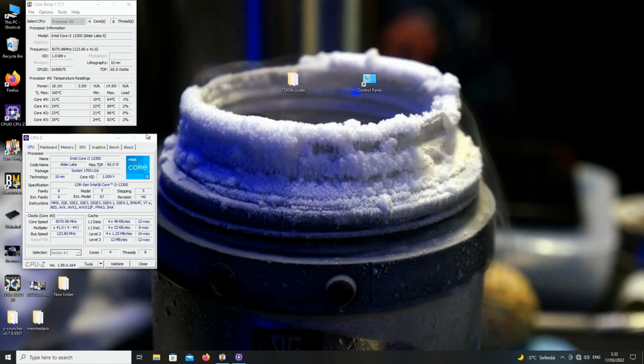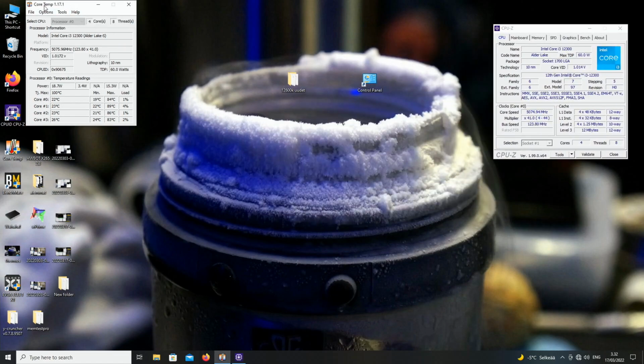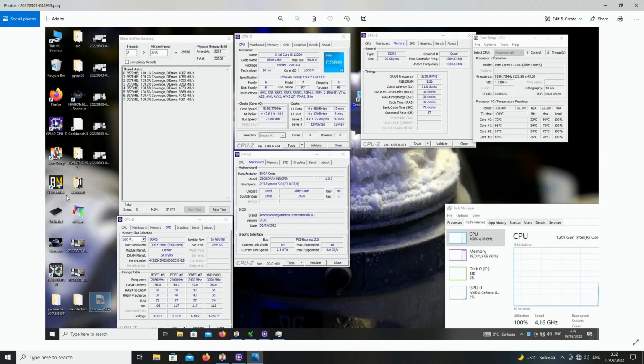And now the last thing is the memory. So as I already said, the maximum frequency I was able to do, fully HCI memtest stable, was 6436 or somewhere around that mark, a bit under 6440. So 6600 was the maximum speed, like 6600 to 6700, which I was able to run in tests like Geekbench 3 and so on, but I just couldn't POST and boot and run 6800 to 6900 plus successfully with the CPU, neither at 100 MHz base clock nor at Ryzen-style base clock speeds like 120 plus and so on. So it's definitely the IMC, not so much about this unofficial way of overclocking. So the maximum memory speed doesn't drop dramatically once we raise the base clock.